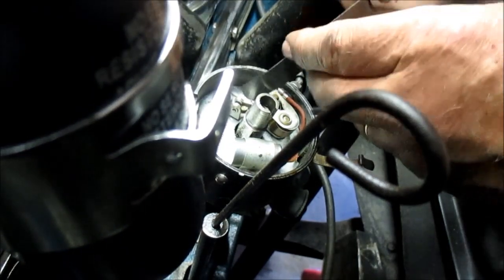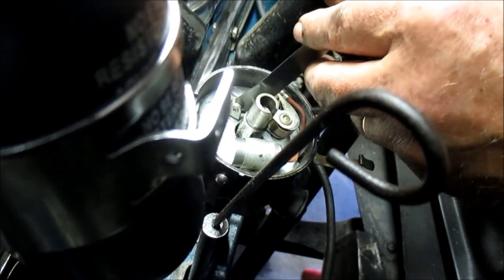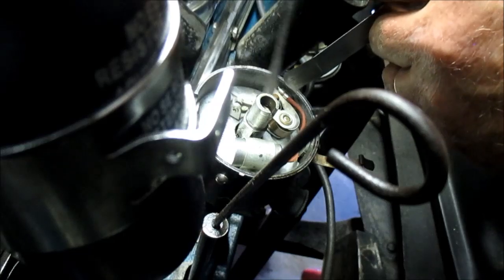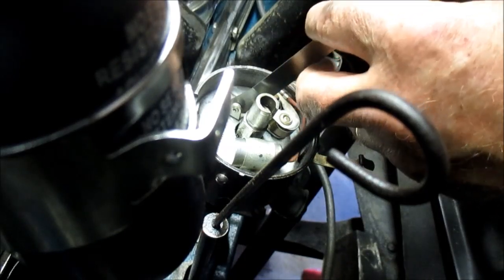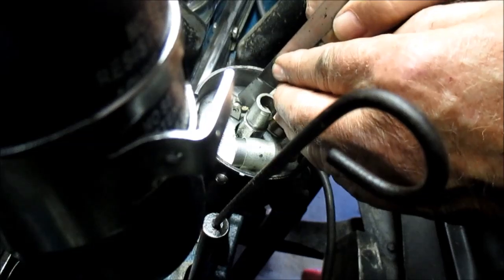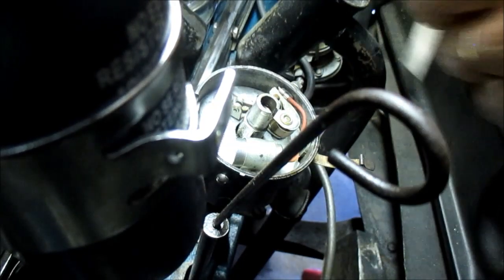Now I'll show this better on the 216. I think I can get a better camera angle. All right, but that's right there. So these points were actually closer than we closed them up to. That rubbing block down there that rubs on the cam lobes, there's 6 for each cylinder. Apparently it wore pretty good. I mean, it got to the point where it would have quit on me. All right, that's 18. That's exactly where I want it. Right there. All right, there we go.